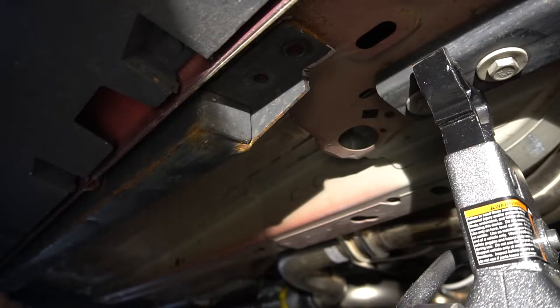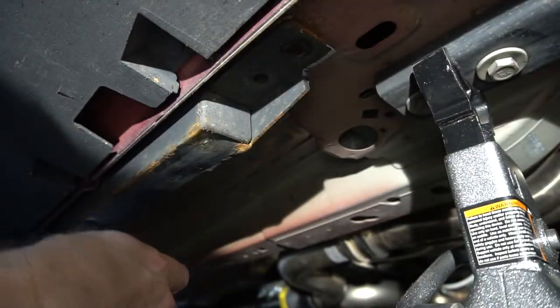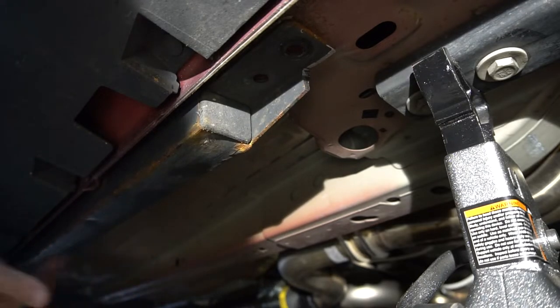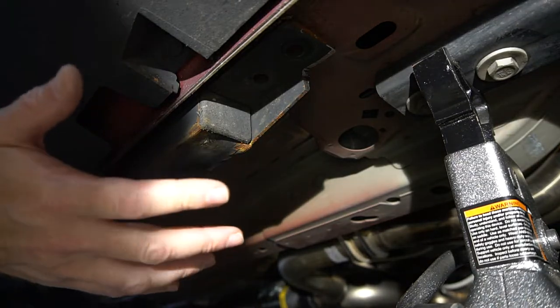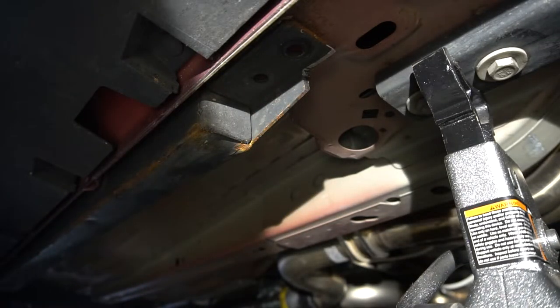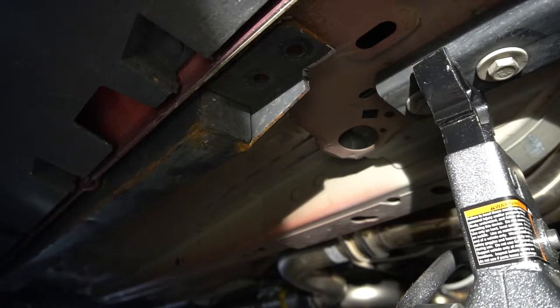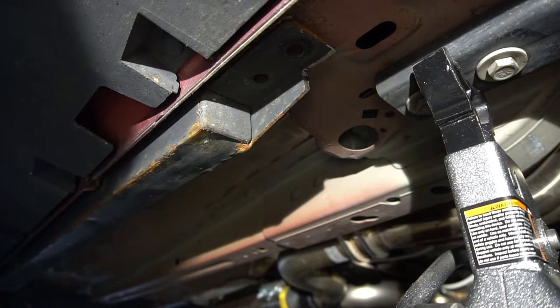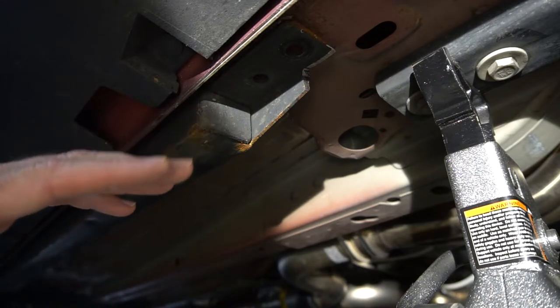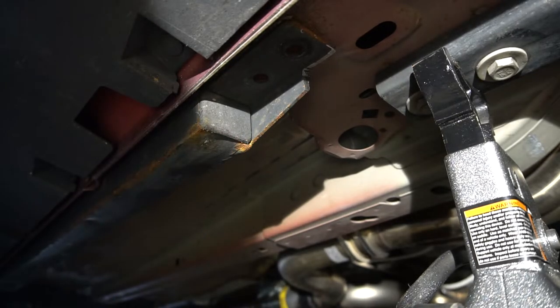So I think what I'm going to do to remedy this is grind off right here where they're coming in contact — make it flush so that the bracket can sit flat against the jacking rail and then bolt it up. I think it'll work. I want to show you guys what I did: as you can see, in the spot right here I just ground that away. Used the old trusty side grinder and took some metal out there. I don't think it's going to be a problem. Once these jacking rails are bolted up it just brings the rail flush against the underside of the car. You can still use it — it's not like it's under major stress or fatigue with these bolts, so cutting that away I don't think is going to affect it.